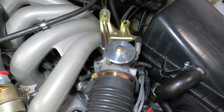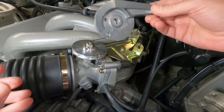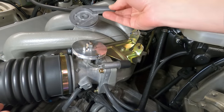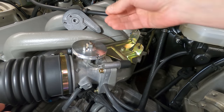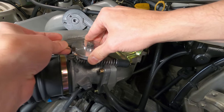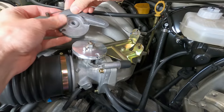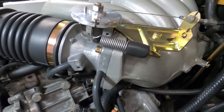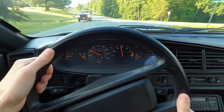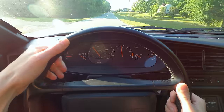A fairly common modification you'll see here on the throttle body is an aftermarket throttle response cam by Only944. The factory throttle cam features a fuel saver arm that slows the initial throttle opening when the accelerator is depressed. The throttle response cam eliminates this initial slow opening and provides one-to-one movement between the accelerator pedal and the throttle, which can make the car feel more responsive. This is an inexpensive and easily reversible mod, as it simply involves disconnecting the throttle cable and removing one nut to swap out the cams, with a bit of cable adjustment at the end. Personally, I've found myself adapting slightly to the new setup for more casual driving, but it's fun to try out if you're looking to change up the throttle response.